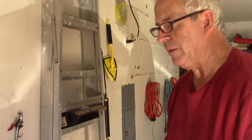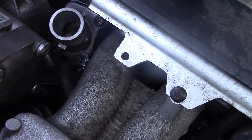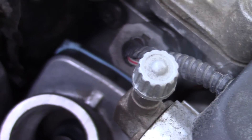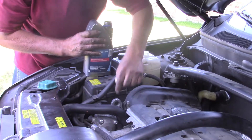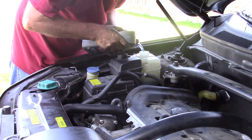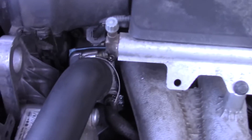On a Volvo you have to put the thermostat in in two pieces — the base first, then the top, because it won't get past otherwise. You made the gasket yourself. You can see the blue around there — that's the gasket. They don't sell that separately, but hopefully the new gasket holds.